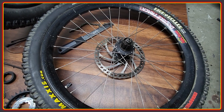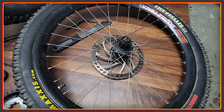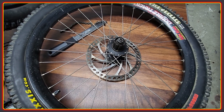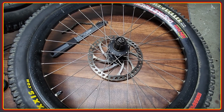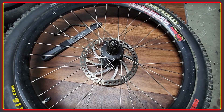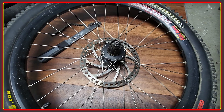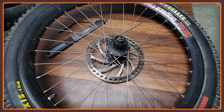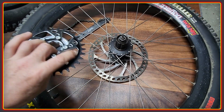I haven't done anything on this for quite a while, but we've been trying to get hold of various drivetrain parts, which hasn't been the quickest or easiest process with shortages everywhere. So this is going to be a single speed bike using the power you get from an ASI controller with BBS HD to give you a high range of RPMs so you can get away with using a single speed.